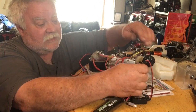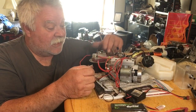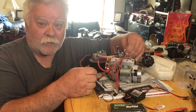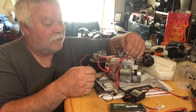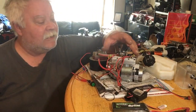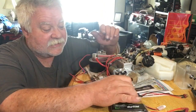But for now, put the glow plug on it — you can actually unplug the glow plug battery after it warms up and let it run. So what do you think guys? I kind of like it on the nitro better than the gasoline. It has a really quick rev, the throttle response is just good, the idle's good. And I think now we can put a clutch on this thing — with that quick rev the clutch shoes will fly right out there. I do know they're making a diaphragm clutch for this with the fingers, that would be very interesting to see.